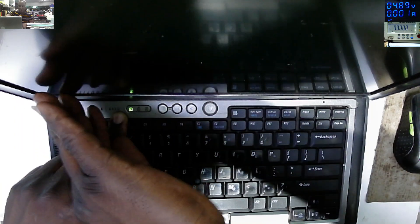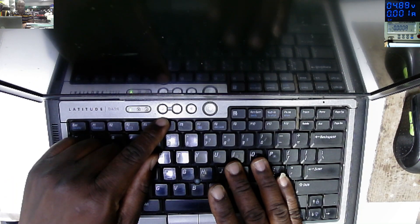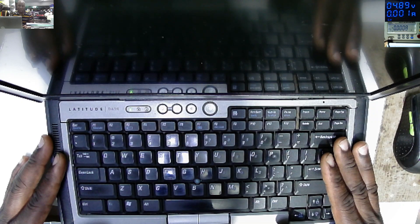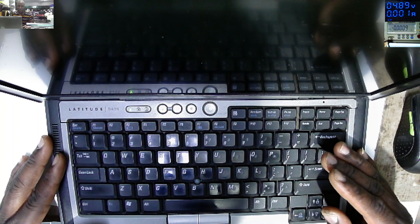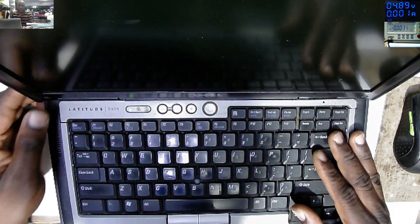You can maybe see a light by reflection on the screen. That light indicates the laptop is on. When I press the power button, the microcontroller reads up all the power supply to check if everything is okay, and if everything is okay, the EC chip communicates with the graphics chip, which should post a picture on the screen. In this case, we have nothing on the screen — no picture, no light, just blank.